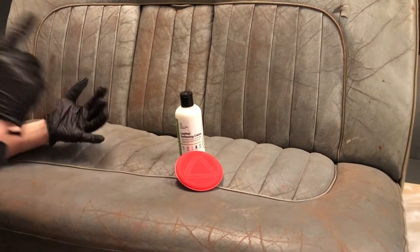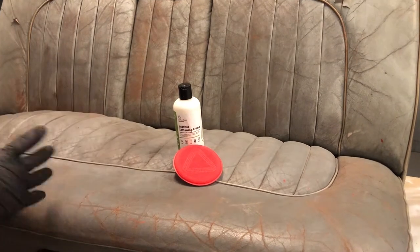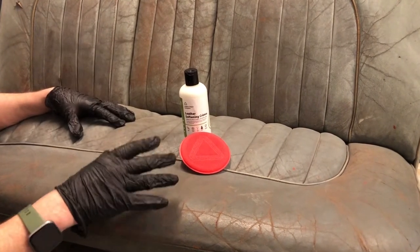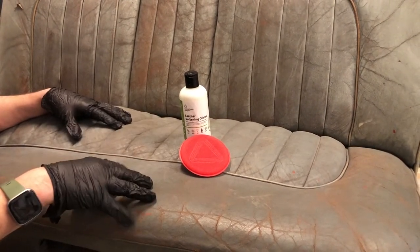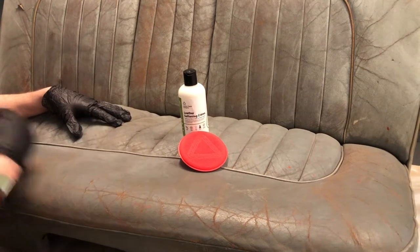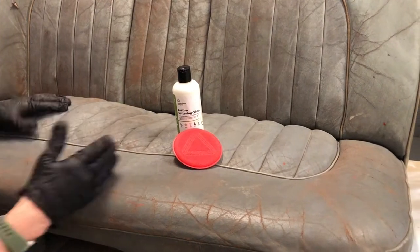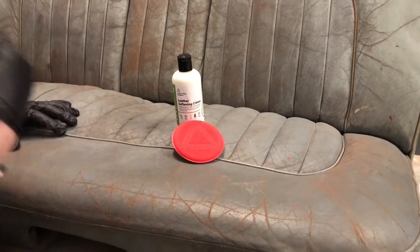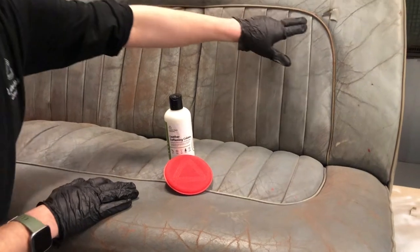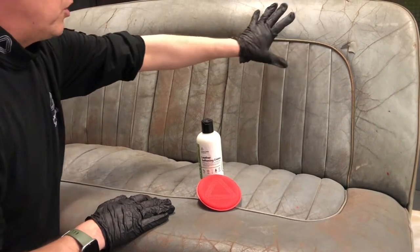The process is: LRC 1 clean, LRC 20 soften, remove surface color, then back to LRC 20 to re-soften the skin again. Getting into the skin more will help soften it a great deal more than it would have done with the color still on. After color stripping and softening with LRC 20, we wipe over with alcohol cleaner, then carry out all the repairs — tears visible up on the top here — which will be covered in the next video.